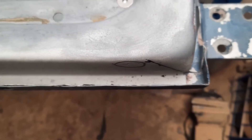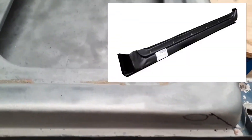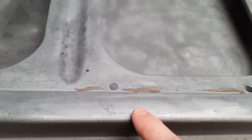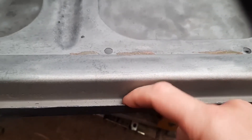What I'm going to do is cut the whole area out and remake a new panel. You can buy aftermarket repair panels for the bottom of the doors — I've had to do that once in the past when I had no option — but honestly they're made of cheap thin steel, the edges are razor sharp, and the pressing quality is pretty crap. So because I can repair just a small section, I'm going to make up my own repair panel and show you a cheat for how to do that without a brake press.